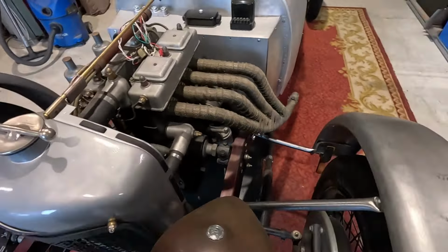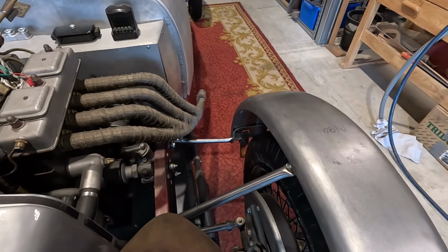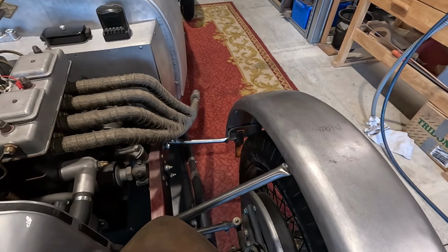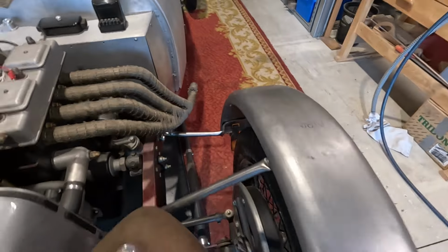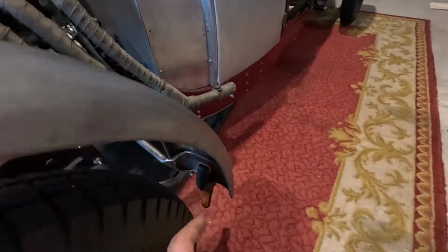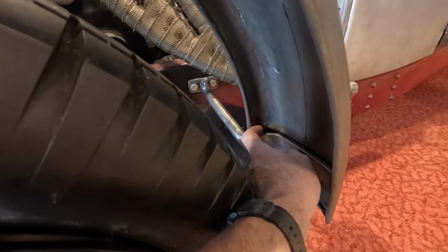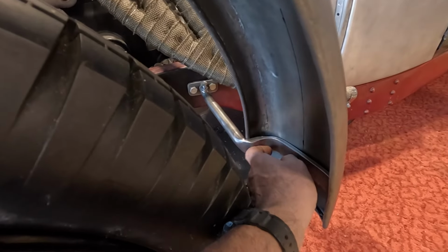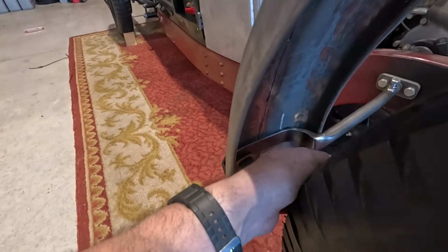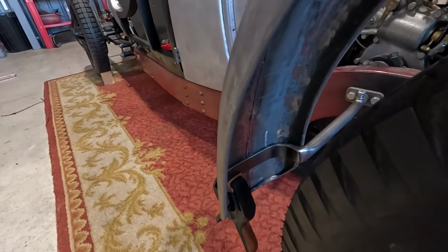And I made the welds sort of on this bit fairly nice. Well, I made welds and then I ground them so they were fairly nice. I did it with MIG, and then I actually went back with the TIG to sort of smooth them off, and that worked really well. The TIG actually worked nicely to build them up and then grind them back. So those are quite nice. I may still build up just in that corner. I sort of welded it up and then ground it off, and I ground a bit too far so it went a bit flat. So I might build up just inside that corner. Mainly because you can sort of see these. Although once the inside of this is painted black, and these are painted black, you're not going to notice that. So it probably doesn't matter.